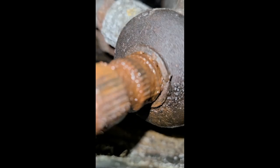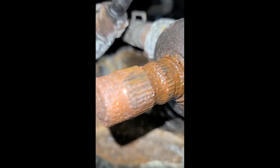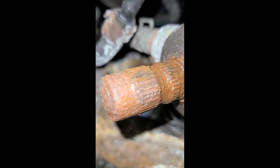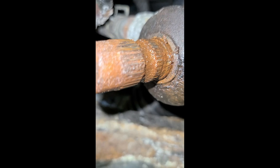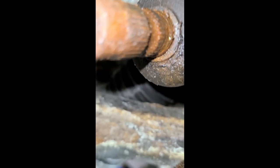This is the lower spline coming out of the steering rack. See those couple cruddy-looking splines? That's where the gap was in the collar. In case you didn't mark your position of your spline before you started — I forgot to mark mine — you can figure out where that gap is by just analyzing the splines.